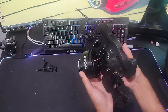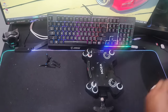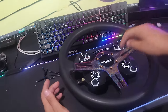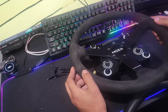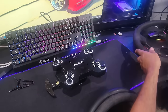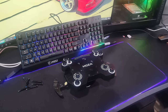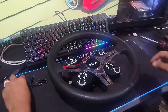There's a single connector in there that's glued — be very careful that it doesn't drop out. When I said you need wheels with flat spokes, you can see this wheel would fit perfectly without contacting any of the buttons. But if you take this NRG wheel, you can see it would be contacting the buttons because the way the spokes are angled upwards. Now if you were to take a deep dish wheel, that's not going to make any difference because the buttons are still there — a deep dish wheel works. But for a flat spoke wheel, you're going to want to use one that is straight.